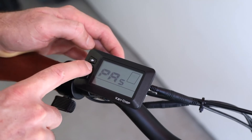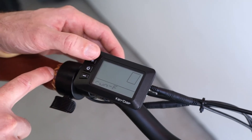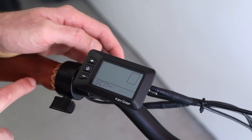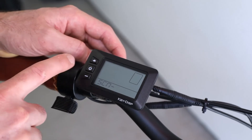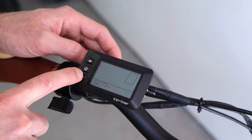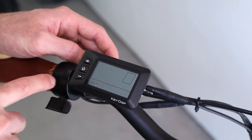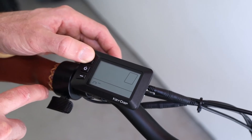If you want your pedal assist sensors to be more reactive to each pedal, let's enter the PAS menu and increase the sensitivity. Leave run F for forward, and let's move SCN all the way down to the lowest number. By default it should be six.